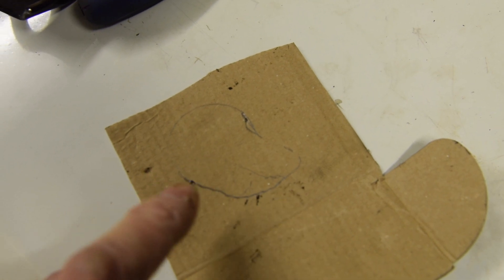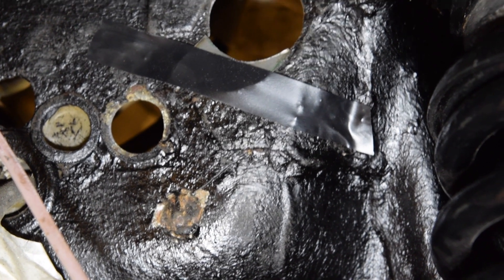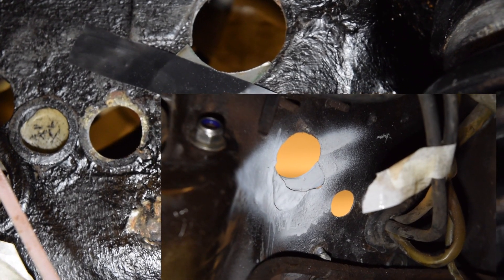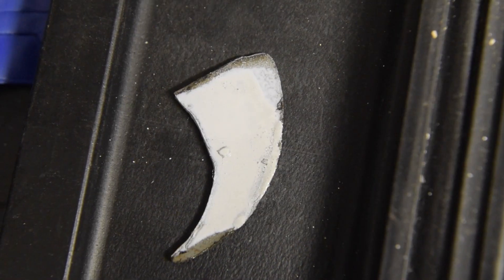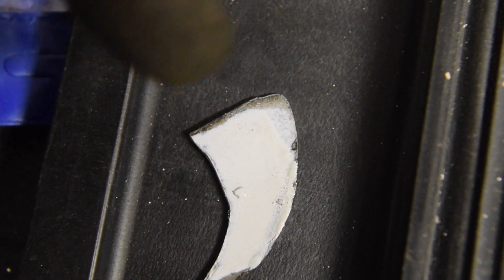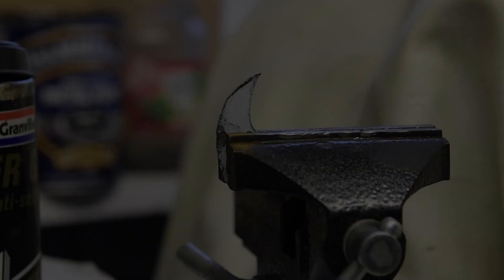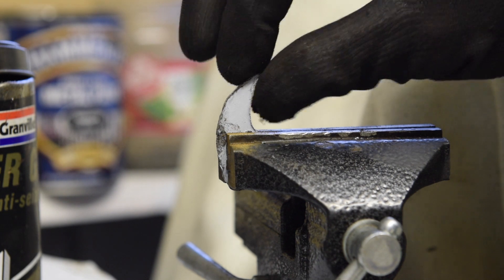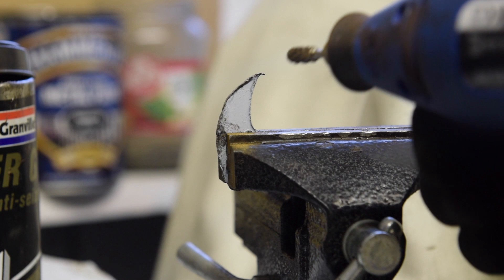Part of the hole is supposed to be a circle where I think the washer screen filler goes through, so I'll create that as well and then cut it out into metal. I've cut a small piece of metal and lightly taped it to the back, then on the other side sprayed grey zinc primer so I can see the area I need to trim off to make it fit perfectly. Using that technique you can see pretty much exactly where I need to trim. I've used my Dremel with carbide heads to trim it - this is pretty much ready now.